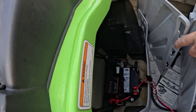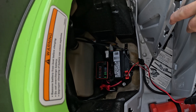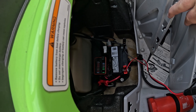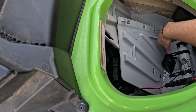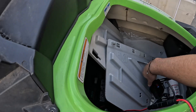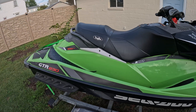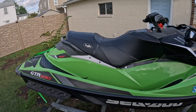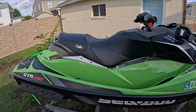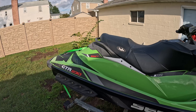In terms of electrical, it looks like there are two drywall screws being used to hold the fuse box in, but the fuse box itself looks perfectly fine. The cover is off mainly because I saw it was loose and wanted to rule something out, but it is perfectly fine. The ski does start up, but it's pretty obvious something is not right — it feels like it's only running on two cylinders. It is definitely a solid, continuous misfire.